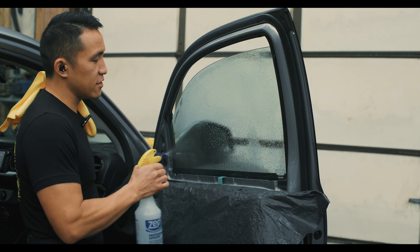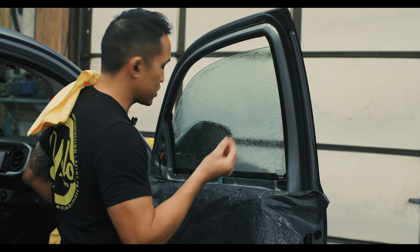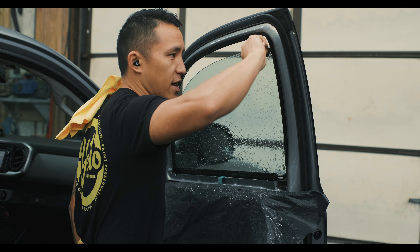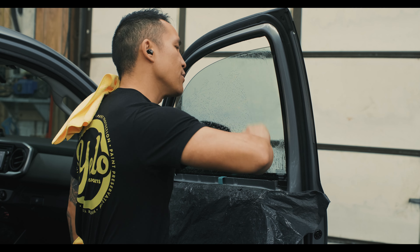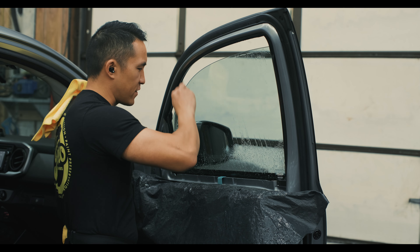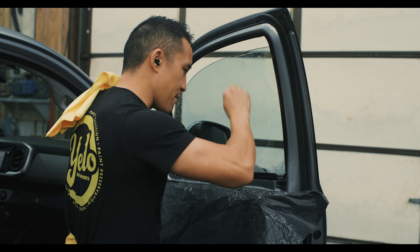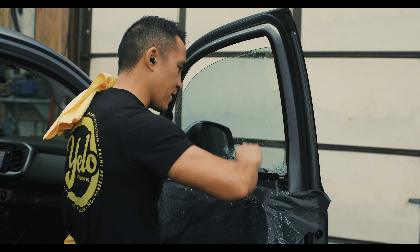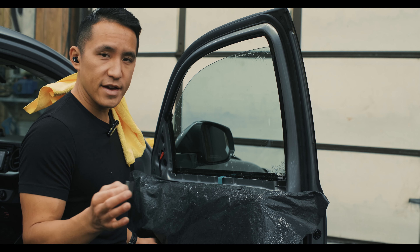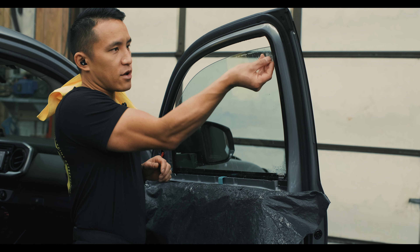I'm going to be a little generous with my slip solution here. The nice thing about bottom loading is I can cover this door card so I'm not too worried about getting everything wet. I'm going to run my blade across the top, nice and parallel — I don't want any angle on this blade, I'm running it as parallel as I can. I'm overlapping 50-50; think of it like mowing the lawn so you don't miss anything. I'm also listening — not only scraping with the blade but listening for anything on the glass. Some glass will have extra defects and little nibs, very similar to a dirt nib on paint, and you can actually hear it.